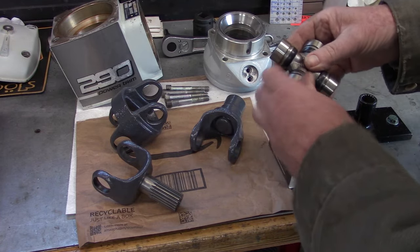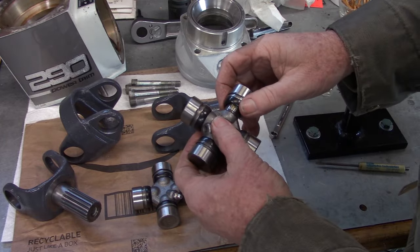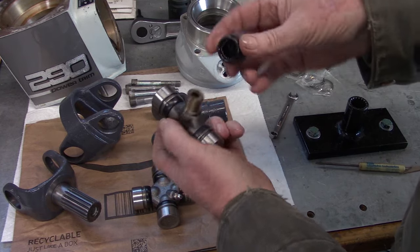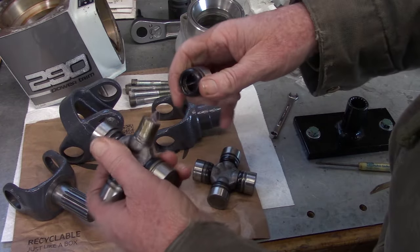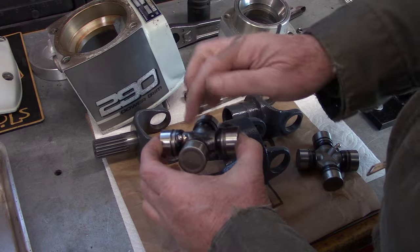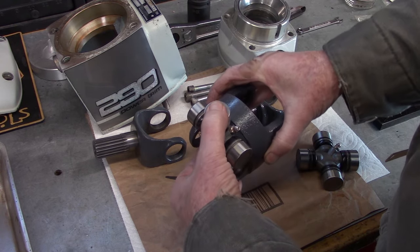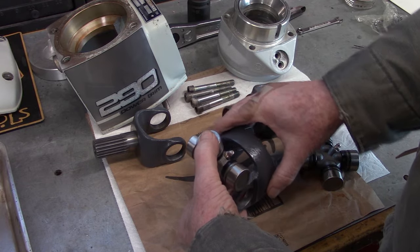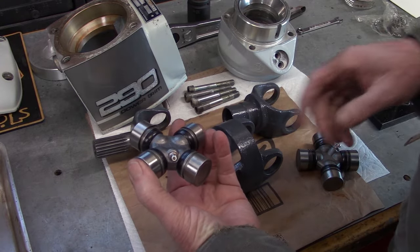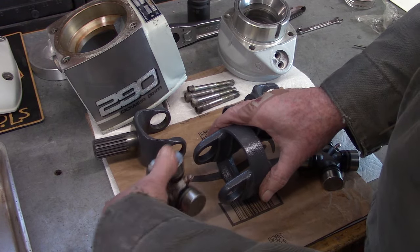The grease in these — I don't like it. I'm going to clean these out and replace the grease with a good-quality synthetic, preferably marine grease. Check this out: they ship these u-joints essentially dry — there's nothing in the cross holes at all. Now we've got our new synthetic grease in there; it's completely full. I like to angle the grease fitting toward the inside yoke — I think it's a little easier to get your grease gun in there when it's articulated. No one's probably ever going to grease these because pulling the boot back is too much work, so I always make sure I get them packed really well ahead of time.